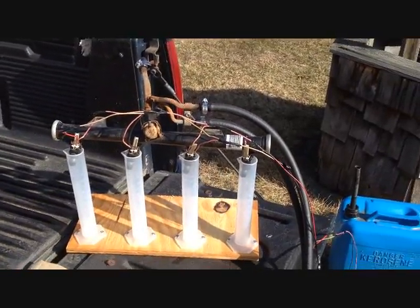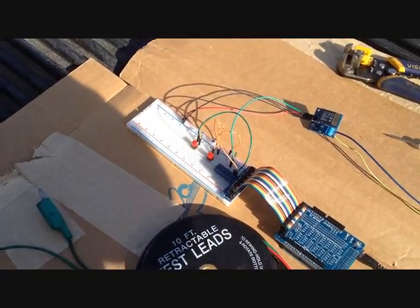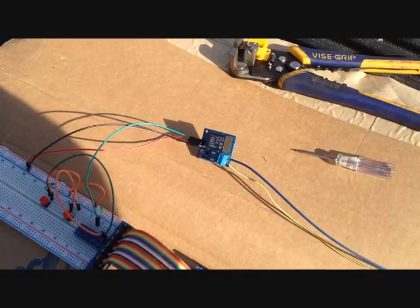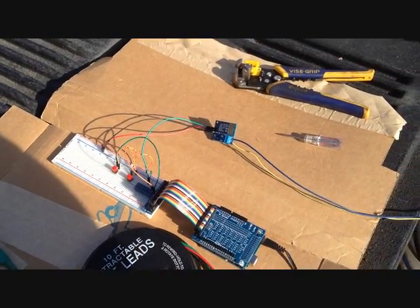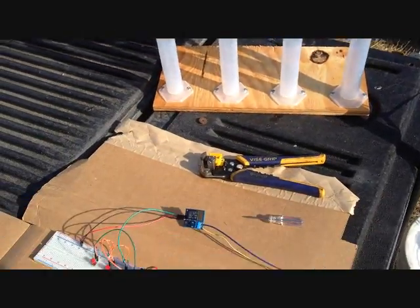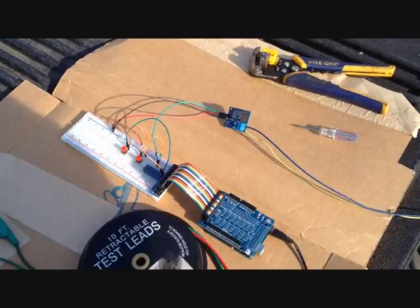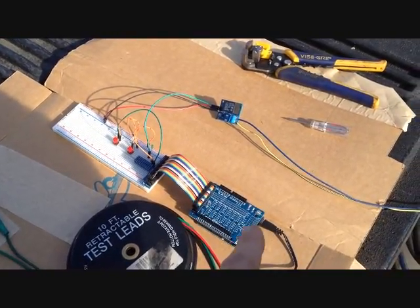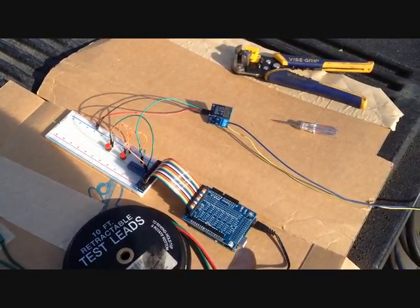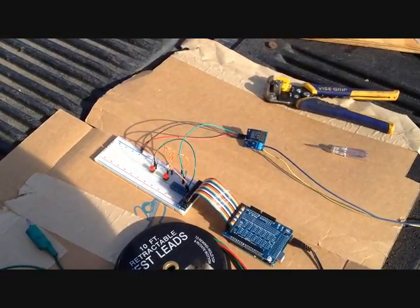I haven't even tried this yet. I've got my Arduino board and my prototype board hooked up to my 5-volt relay — it's a 5-volt control relay setup that came with the board; I got a whole starter kit with it. That relay is then controlling the ground side of the fuel injectors. Eventually I'm going to get rid of the prototype setup and just build an enclosure for that board with a couple buttons on it, time-adjustable by USB. One button will be static flow and the other will be dynamic flow.